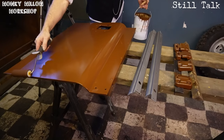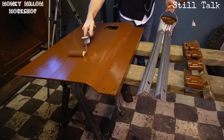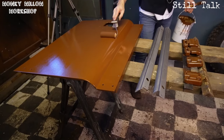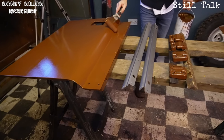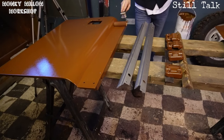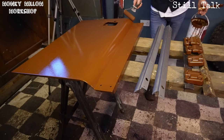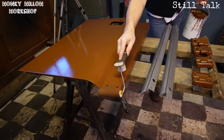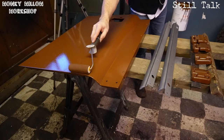These are actually repo doors — not the expensive ones. If I was doing it again I'd probably buy the galvanised frame ones. I had to take the skins off the frames because the frames had no paint on them. You've got bare aluminium onto bare steel, and we all know what happens with that. So I had to paint the frame two or three times, paint the skin two or three times, then put the skin back on the frame.